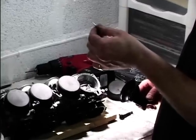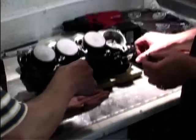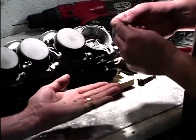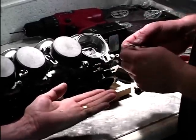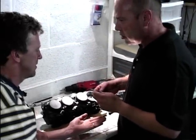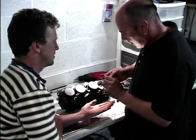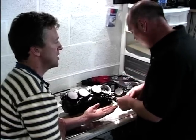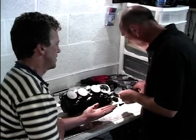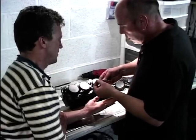This is the new needle. You'll also find a circlip for it and a washer. They're very fiddly, these things — this is the tricky bit. There's a circlip and a washer. The instructions say that circlip must go on the third groove. Third from which end? Because there are five grooves — it's in the middle. It's always from the top — so it goes on the third groove. Just take a little pair of pliers. Reflect it to position — perfect. So that's now on the third groove, we're ready to go.